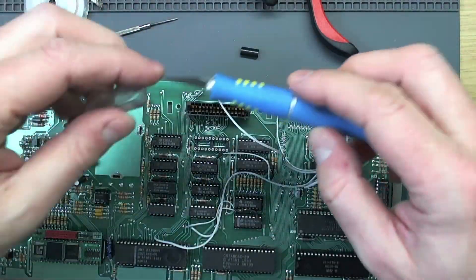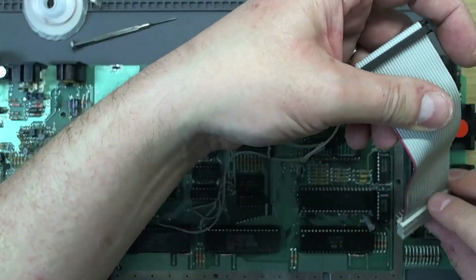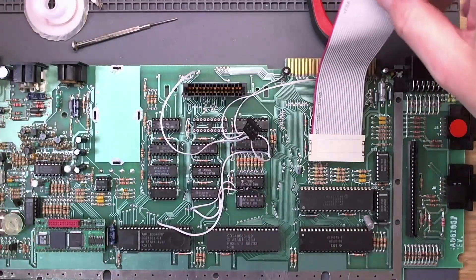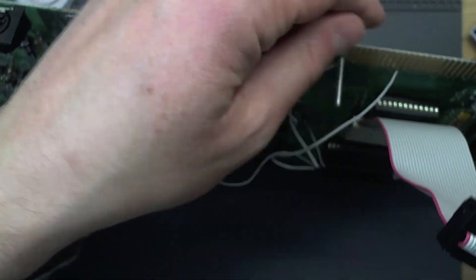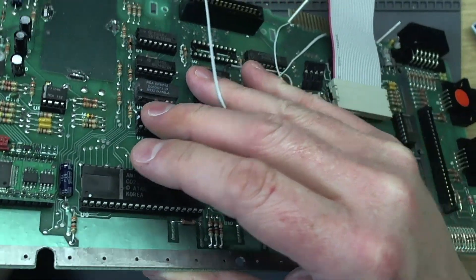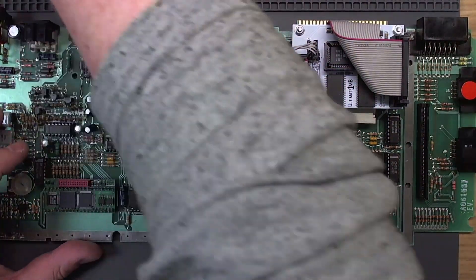Couldn't get much tighter than that. Hopefully it will work and nothing will short out. Another screw — put nylon washers on the bottom. The way these ribbon cables go — I'll tidy the cables up later, I know I always say that but I always actually do it. The whole problem with this kind of computer is that you're constantly trying to save space, so you really can't afford for any standoff or anything to be longer than it needs to be because you're going to have trouble getting the lid down. If we turn it on now it should hopefully work.